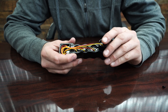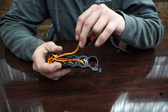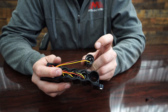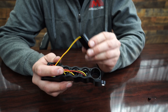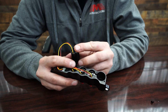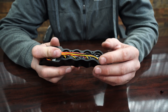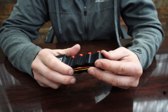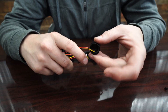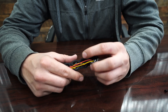You'll look and see that there are actual little pods. These are really nice — if you look on the inside there's an o-ring that seals them from vibration, and then the sensor itself is actually silicone-potted into this metal pod. So everything is very redundantly isolated from vibration, which makes for a long-life sensor and gives you the ability to run it in really extreme conditions. You'll also see that the top is keyed with flats so that when you go to tighten your 1/8-inch or 3AN fittings, they're ready to just be tightened.